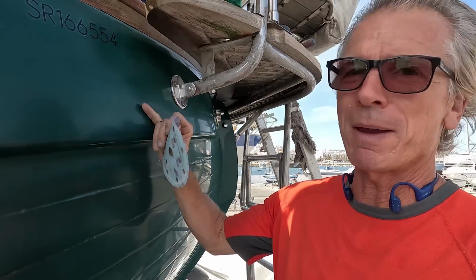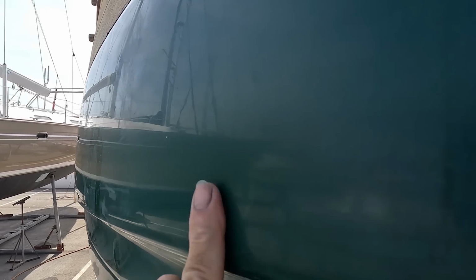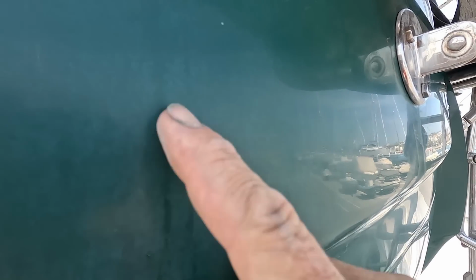Second thing I've done is, when I was first doing this, I was doing a section completely at a time. It's much better to let it dry properly. When it's dried properly, if I have a look on this bit here, I'll see how well this shows up. I'll try and show you a couple of different angles. You'll get some areas that are completely dull because it's not been polished, but there's nothing in there underneath, whereas this bit here, you can still see there's some blooming underneath, so that needs a little bit more. So once it's dry, you can then just work on those bits.